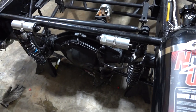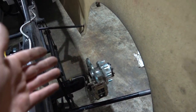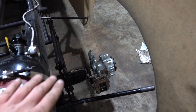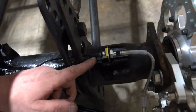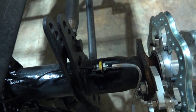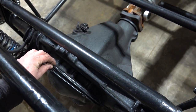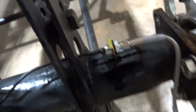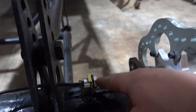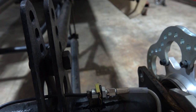Last night we were working on our brake setup — the TBM brakes from Firepunk and our IMS setup from Chase Ringer. Got everything in. We had to run our lines. The big line coming from the junction block actually has a 3/16 flare fitting already on it, so I was able to do that last night. I'm very happy with how we ran it — just right up and over the axle. Our little brackets are welded on and we have our little junction fitting to our stainless hose. We didn't have to re-flare anything. Worked out perfect.